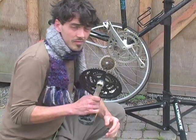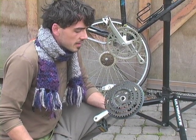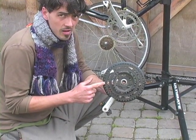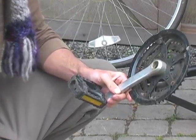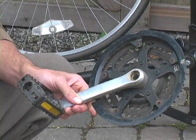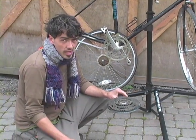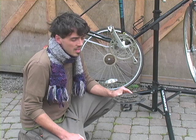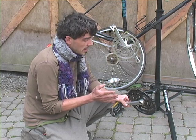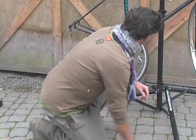This one is also not the one. We talked earlier about 10-speed road bikes and how mountain bikes typically have a triple on the front instead of a double — this is an example of a triple. The problem with this one is that it's welded together. It looks like you have five chain ring bolts, but it's actually just one piece all welded together, so you can't separate the chain rings to get a single chain ring for your conversion. There's also some funky stuff about chain line spacing and back spacing with mountain bike cranksets — you'd be better off using a road bike crankset.